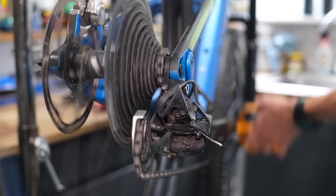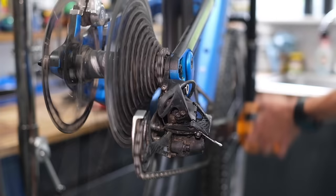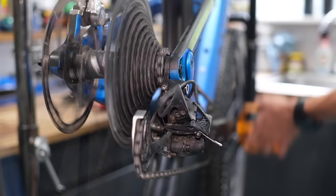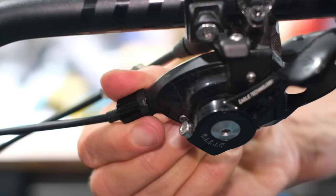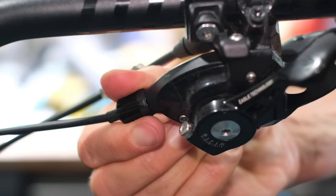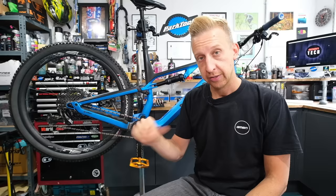The first part of indexing your gears is to see if the derailleur jumps up with one click at the shifter — the aim is one click per gear. Try this by cycling the bike with your hand on the pedal and just changing gears at the shifter. This makes sense if you've got your bike in a work stand — if not, you might need a friend to help. A work stand is essentially a third hand and very useful. Cycle through one click at the shifter and it should hopefully correlate to the derailleur jumping up one gear. If it's not quite managing to jump up, you need to apply a bit of tension using the barrel adjuster at the shifter to compensate for slack in the system.